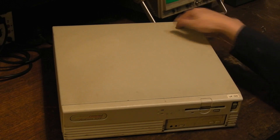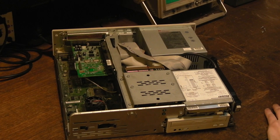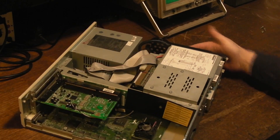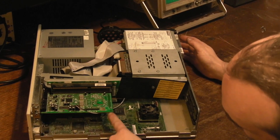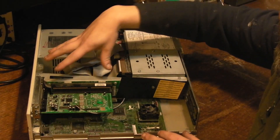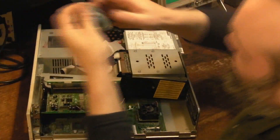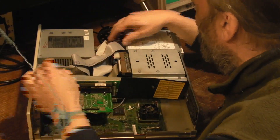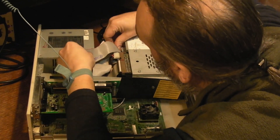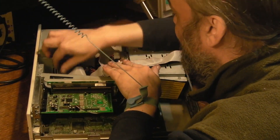I've already taken the three screws out of the back so we should just be able to pull forwards and lift the case up. Now first thing, let's see if we can identify where the battery backup for the CMOS is. We've already had the sound card out. Let me just grab my anti-static - I haven't got a mains lead connected so we'll stick the static precautions on. We'll unplug that from the floppy drive first anyway because we are going to be pulling the floppy drive out.